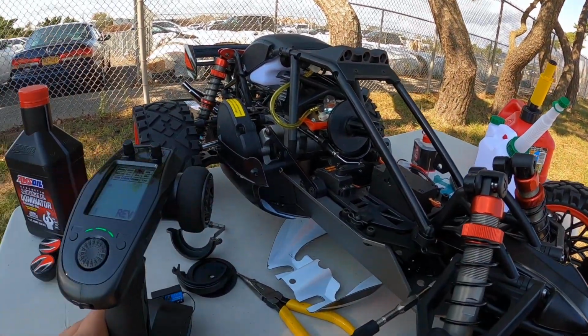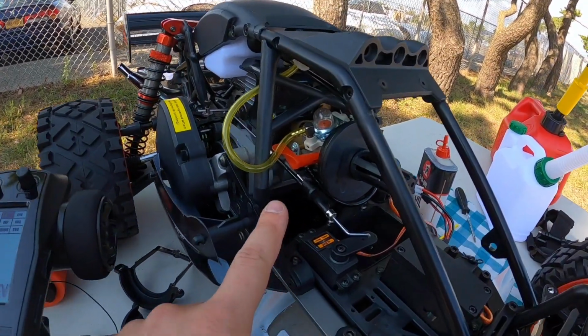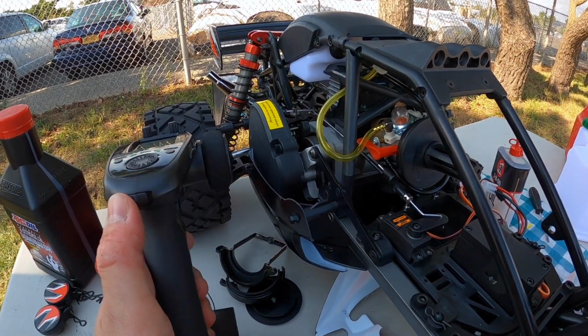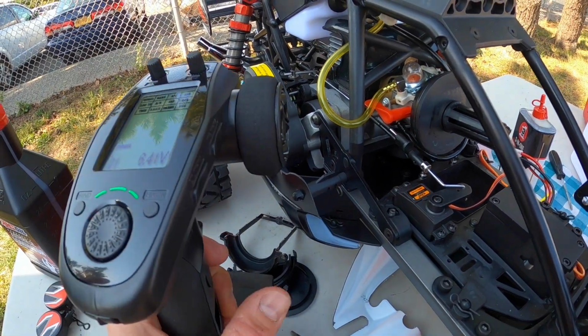Let's just see if our failsafe is activated. Now, when I turn off the remote here, we wanna make sure that the brakes do engage. If not, then I will just simply set it on the remote. Let's see what happens. I'm gonna activate. Okay, so we have no failsafe yet. I am gonna be setting the failsafe right now.